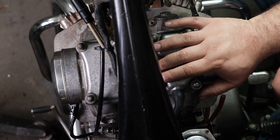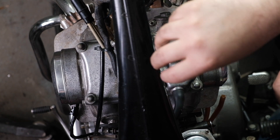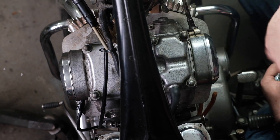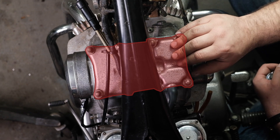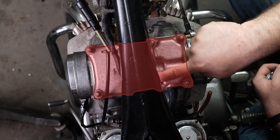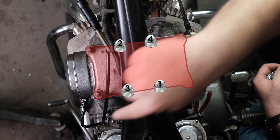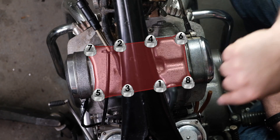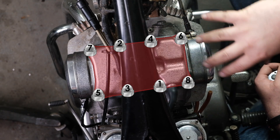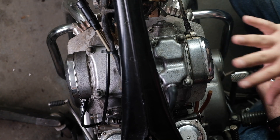Let's jump in and look at the cylinder head up close and get this torqued. Typically on something like this, you start in the middle of the part and work your way out to the perimeter in a criss-cross fashion — very much like putting a tire on a wheel. According to the Honda service manual, our number one bolt starts right here, then criss-cross to number two, back to number three, four, five, six, seven, eight. It's a constant criss-cross, bringing the part down evenly rather than going straight across one direction, which can cause uneven torquing and gasket sealing.